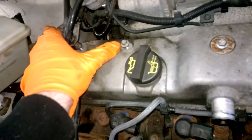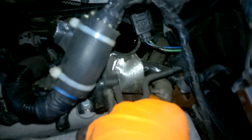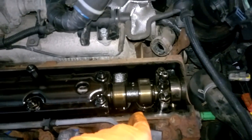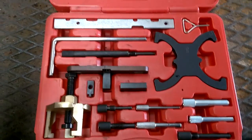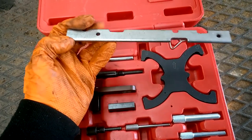It's 8mm bolts along here. I have this insert disconnected and slung up all the way, and that bracket disconnected — that's two 8mms as well. The only thing holding it down now is three more 8mm bolts, and at the back there's a clip that I need to remove. Rocker cover is now up and out of the way. Make sure you pay close attention to the seal on the rocker cover and don't damage it — it can get stuck, so be very careful. Now you can see at the back just there — that is where the locking tool goes in, and this is the special tools kit we'll be using to hold the camshaft.